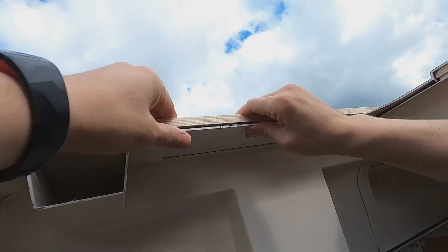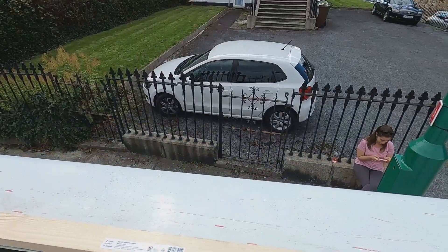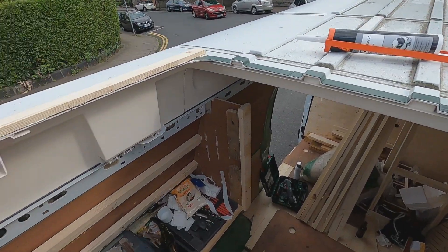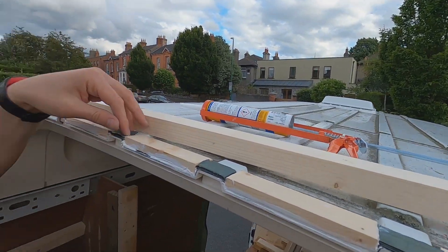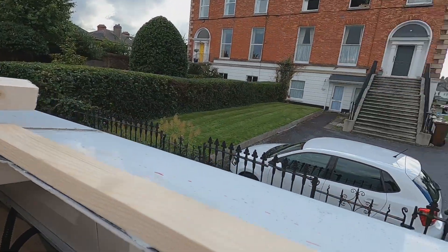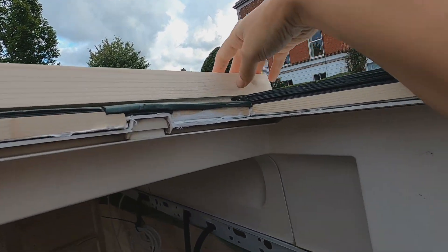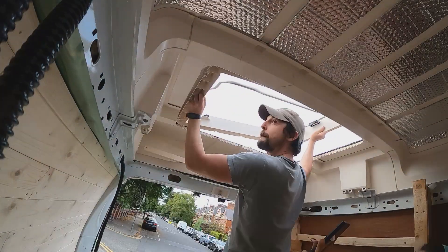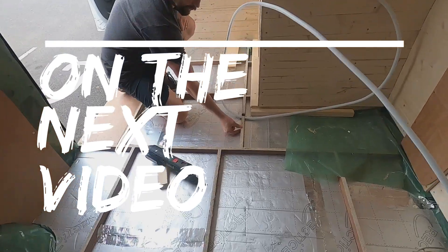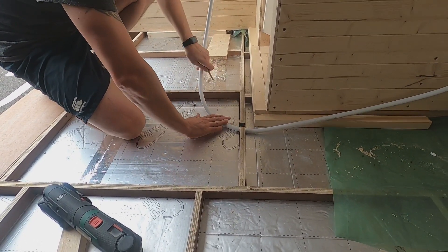You're going to see what we're doing to deal with the skylight. Because we had some leaks on the previous van, we're trying something different. A couple called Foxy who are also building their van used this green sticky material, so we're going to use the same to waterproof the skylight. The roof is really irregular but you can see all the layers we used to keep everything level. We really believe this will work much better than before. That's it for today — thank you for watching, and on our next video we'll be in Port Marnock.